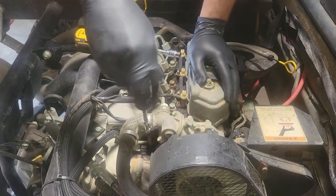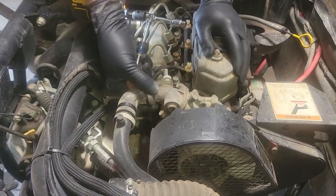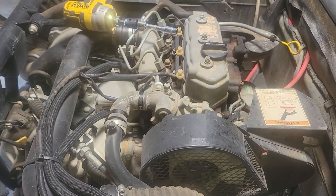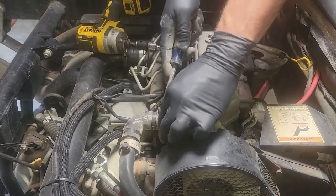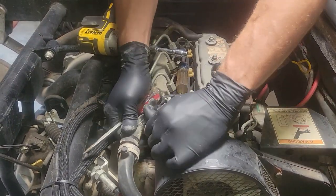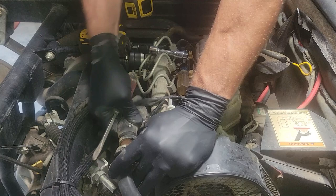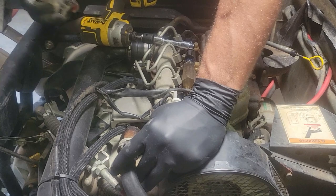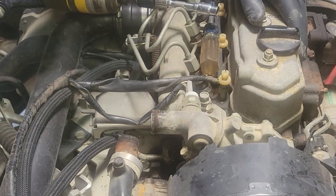Let's take a look at the thermostat. We'll see how much water this thing has in it. He says he didn't feel like it has any, because he said it kept blowing it out and it kept overheating, and he was just kind of fed up with it. Tell you what, we definitely flush his. We're gonna have to flush that radiator because it was just rust in there.